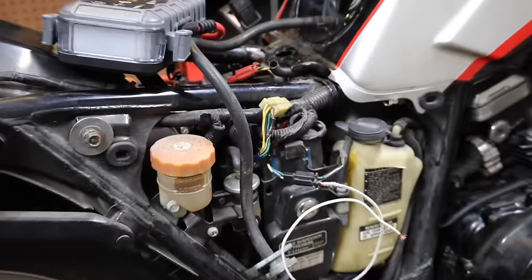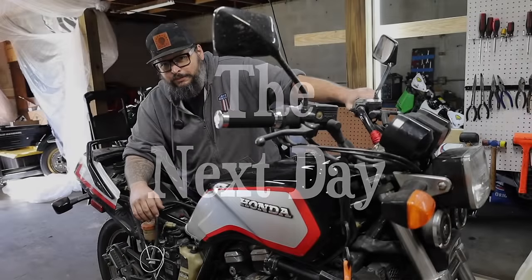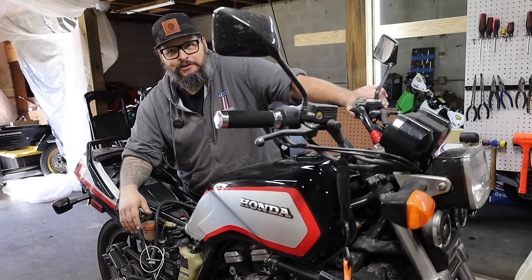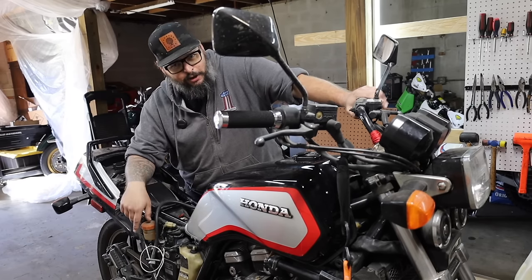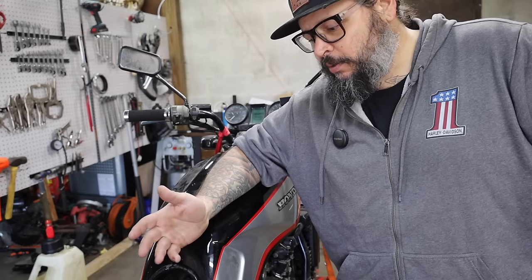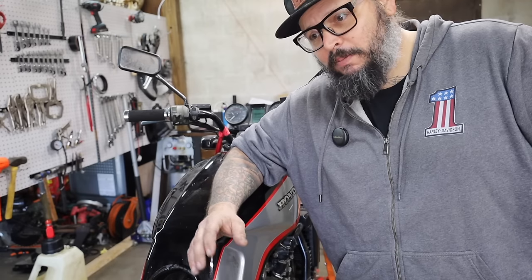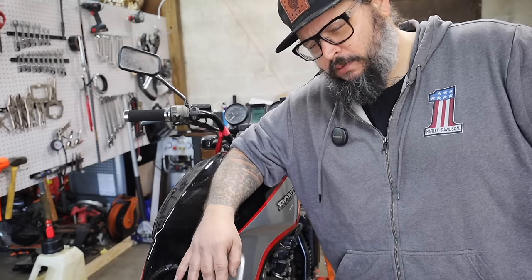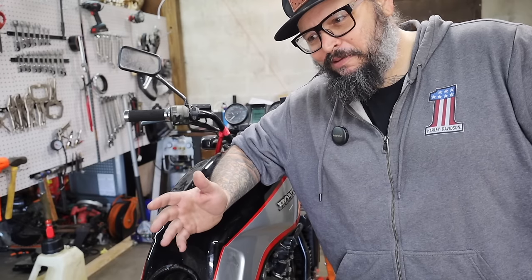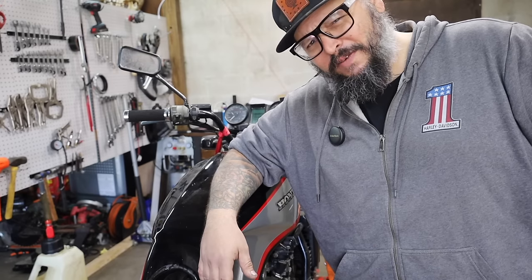I put power to the fuel pump and we've got power coming from the fuel pump, but even though I ran it, I still didn't have any fuel in the carb. Nothing will stop you in your tracks like a dead battery. It's the next day — I ran the battery down solo, then I ran my jump pack down solo, and figured it's time to call it quits. With the help of Joe the Mountain Jedi: the fact that it would run on ether means we got good spark. The bike was running on ether — we just weren't filling up the fuel bowls. It literally just came down to a bad connection. Joe wiggled some wires around and chased it back down to the box that controls when the fuel pump comes on. These are complicated bikes — that's why I want to learn them. There are also a few redundancies in how the fuel gets to the fuel pump which I'm going to eliminate. It's very hard to diagnose anything unless you have a fully charged battery when it comes to a motorcycle or anything like that. Decided to leave the battery on the charger overnight.